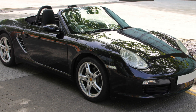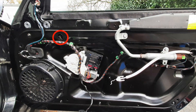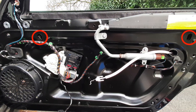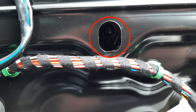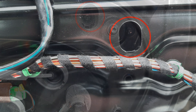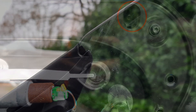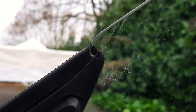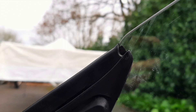Prior to taking the panel off, you want to make sure the glass is as high up as it can go. The red circles indicate the two T25 screws that hold the glass into position. Undo these screws just enough to allow the glass to move in its sliders left to right. I adjusted the glass as far left as it would go, and height-wise I adjusted it up so it's just deforming the rubber trim that you can see.